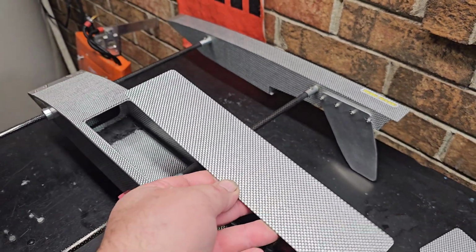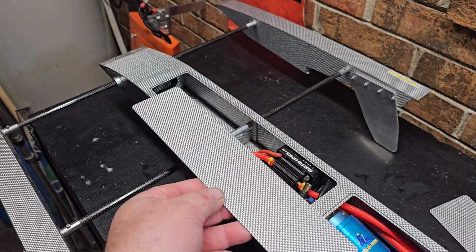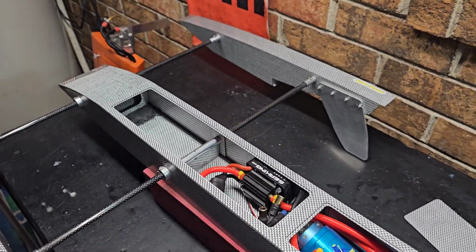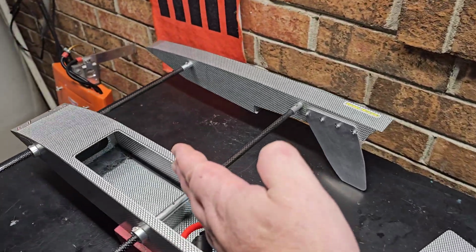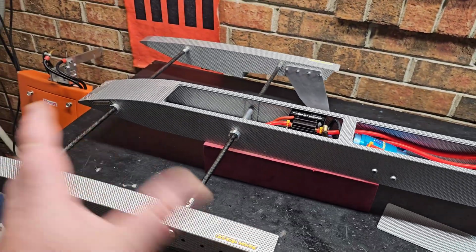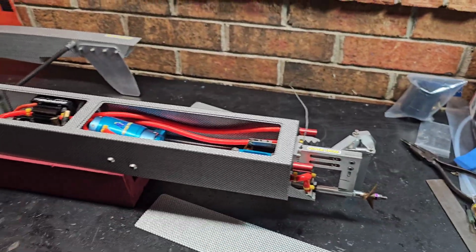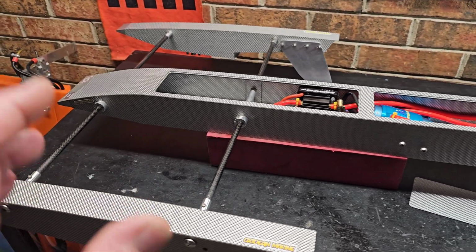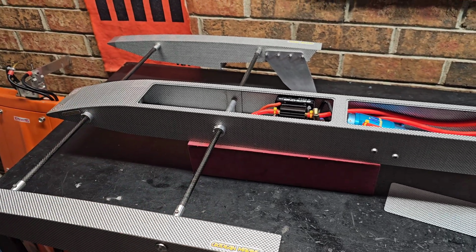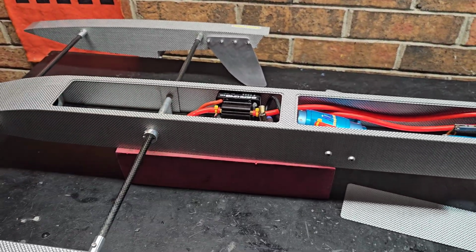You guys seen the first run, the tub was offset to the right in the sponsons, and then the second run, the tub was slightly offset to the left. About the same offset, about 7/8 of an inch both ways. And it actually handled better offset to the left with the little bit of toe in. So with a rigger, there's right ways, there's wrong ways of doing things. I guess every boat is different. Every boat has its own way it likes to be set up. And I guess it's just up to the end user to figure out what that particular hull likes.